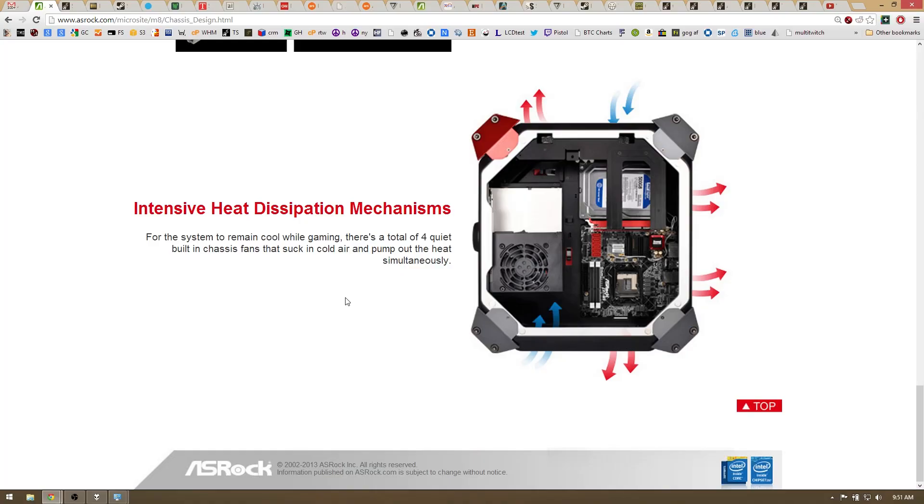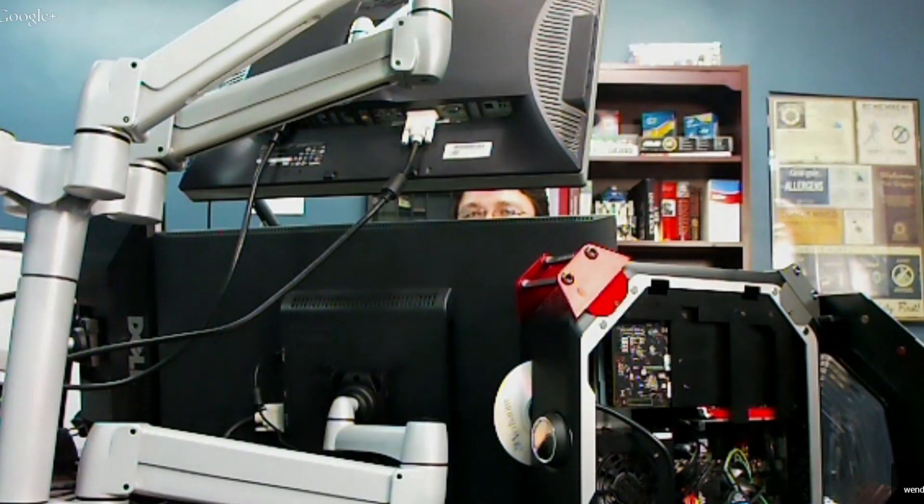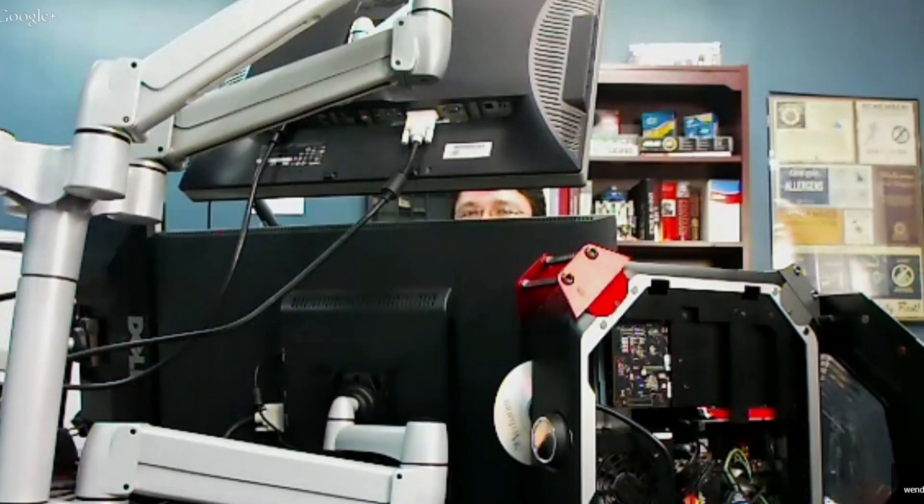Can you see any configuration where the in-and-out on both top and bottom might work? I think if the bottom fans were configured for intake and the top fans for exhaust, that would probably also work, although it wouldn't draw air in from the back. The video card you have may be designed to exhaust air out the back completely — the stock AMD coolers are pretty much designed to do that. In our case, the ACX cooler exhausts hot air out the back and the top edge, so having the top fans configured for exhaust is a win-win, pulling the hot air off the GPU.